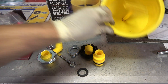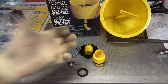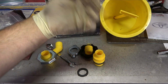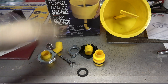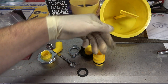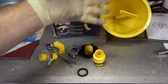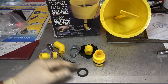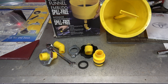You stick it in the radiator with the car cold, you fill up as much fluid as it will take, then you fill the funnel about halfway, fire up the car and run it. I kind of squeeze the hoses — squeeze that upper hose to help those air bubbles move along. You'll watch giant bubbles of air come out and the level will drop. Do that for about five minutes, or if it's really stubborn, do it all the way until the thermostat opens up. You can see all of a sudden new coolant coming in — we usually use chameleon, which is a yellowish color, so green or pink or red will come through. I just did some cooling system work, so let's go over and I'll show you how it actually works.